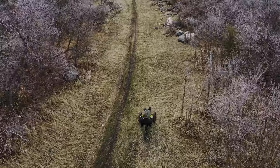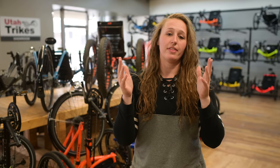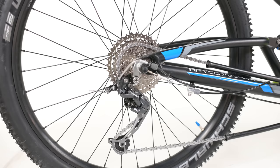There are a handful of features that make the Enduro so capable as both an off-road trike and a potential touring machine. Starting with gearing — at first glance, most people will see the single crankset up front and think they've been duped. Don't be fooled. The Enduro's 26-inch rear wheel is built around a Sturmey Archer three-speed hub and is paired with a nine-speed cassette. The hub is low maintenance and can be shifted while stopped or coasting, making it a great option for riding with lots of flying debris or when you're tackling a lot of hills.